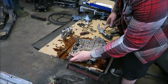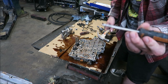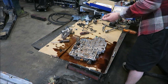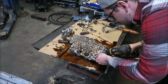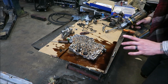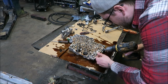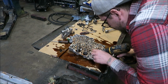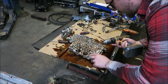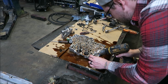The first thing we're going to do is center punch this wall right here so that the drill bit doesn't try to walk too much, because it's going to be at quite an angle. If your real center punch is broken, you can take an old screwdriver, grind it to a point, and it does pretty good. The TransGo kit does come with all the drill bits you need. Once you're done with that, step it up to a 3/16" bit, which is also included in the kit. Be extra careful not to get anywhere near the edge because this one's much larger.